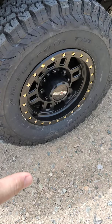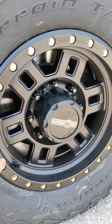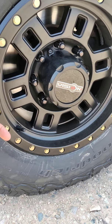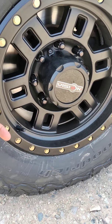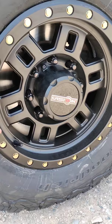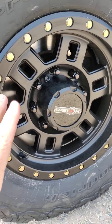This whole setup from Discount Tire was $1,450 out the door, mounted and balanced. If you run a 16-inch wheel as opposed to a 17, you will have issues with stick-on weights — they'll use a clamp-on on the back lip to balance it. I ordered balancing beads for these, and in a couple days I'll have those in and I'll never have to think about it again. Also, the clearance on your brake caliper is very tight to this wheel — not a problem, they don't hit — but just watch when they install the weights.